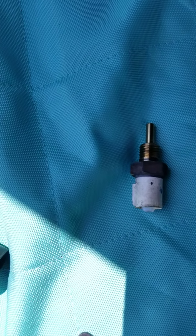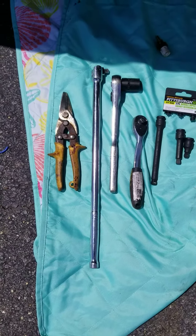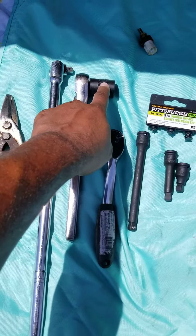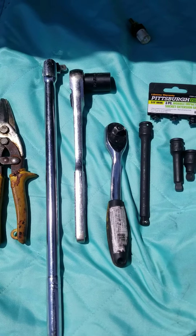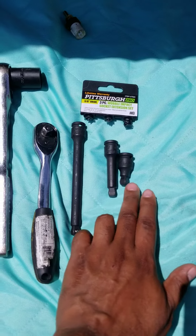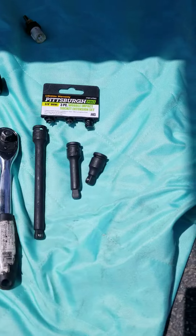You're going to need a breaker bar and a 3/8 ratchet that's fairly flat, because you won't have much clearance. You'll need a 1¾-inch extension and a 19mm 6-point socket, because it's heavily torqued — a regular ratchet won't cut it. I bought this at Harbor Freight; the 3-piece set comes with a 6-inch, a 3-inch, and a 1¾-inch wobble extension for about ten bucks.